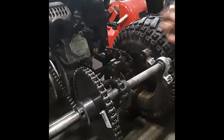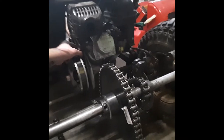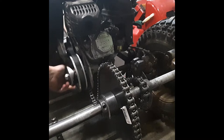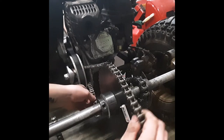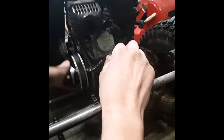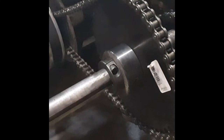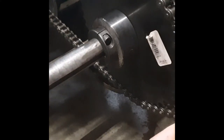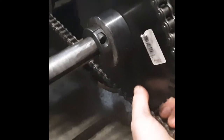What you want to do is get it around the smaller sprocket. If you've got a centrifugal clutch, this works too — just go on the sprocket of the centrifugal clutch. All this stuff can be applied for other drive systems that use roller chain. You've got some chain coming out the bottom, and now you want to get the back side of your chain around here and make sure that the top is tight. Always, always, always, if you can hop it one more link over, do that.